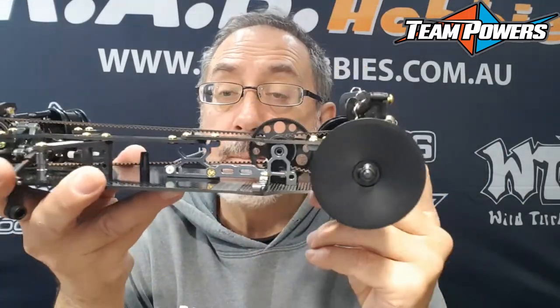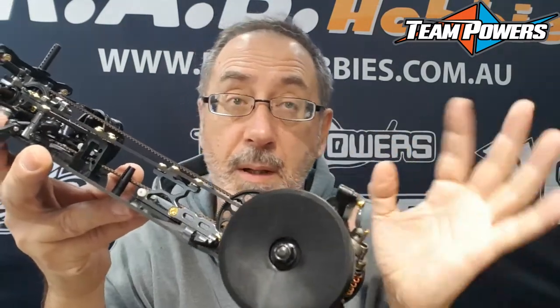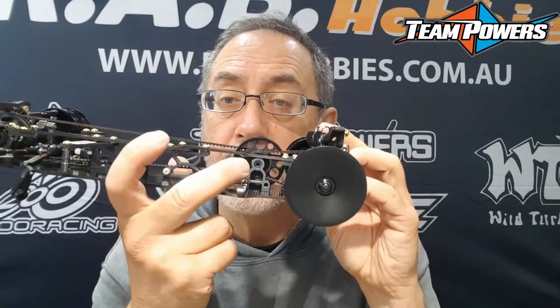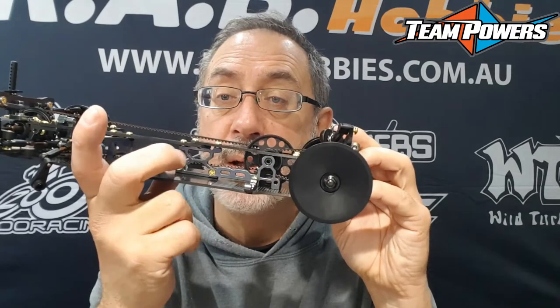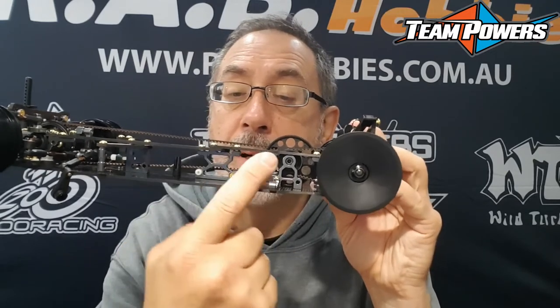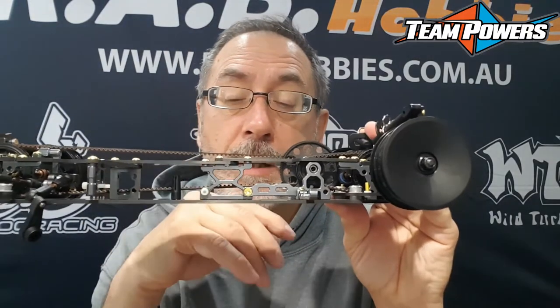The motor mount is three pieces, which makes it easier to do a mid-conversion, because everything basically just crosses over and there are only two items in the conversion kit that help you do that. The motor mount is bolted to the carrier for your spur gear. When it moves to mid-mount, it just goes to the other side, which is really good. This brace is used as well — you're literally just flipping everything around and moving it, so you've got the spur in the middle, the motor mount, and that brace sitting at the back.